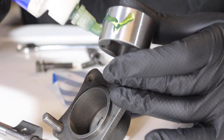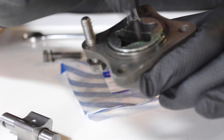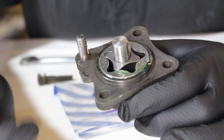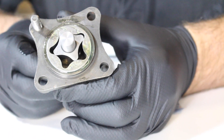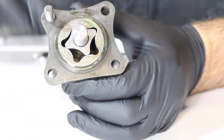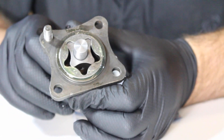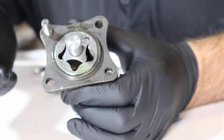So put a bit of that in, and then that's inside — it's really sticky. Now the other part of the oil pump goes in there. When this spins, oil gets picked up in this hole here and as it spins that gap gets smaller and smaller, the oil is then pressurized and pumped all around the engine. We want some engine oil or assembly lube in there — we don't want to put it in dry because when it first starts up we don't want metal on metal. We want at least a nice film of oil in there.